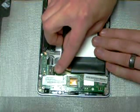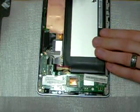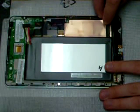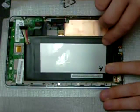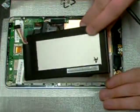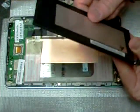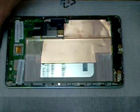Always pull straight out. For the battery removal, start at the end — at the very bottom here by the speakers — and lightly pry it up until that tape releases, then you can slide it in. Keep it real close, because if you press any further towards the middle here you'll actually break the LCD. About $150 to replace one of those. If yours is stuck on, this part will come off first, then this last part's a bit harder because all the circuitry for the battery is right here on this end — be real careful not to bend it. This battery's got an A rating, held up a great charge through all my testing. We're going to go ahead and put that away for now.